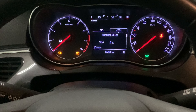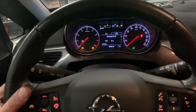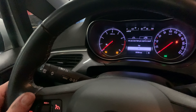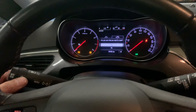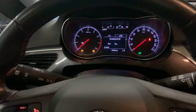Once you are here, the indicator says it's due for an oil change. Just press the set button once. Then you'll get the question: 'Are you sure you want to reset?' Turn the wheel to confirm you are sure and press this again.